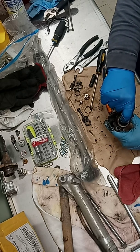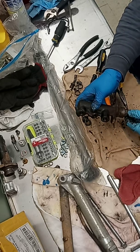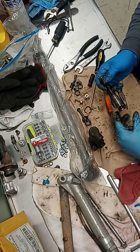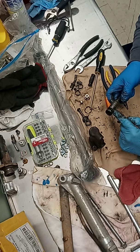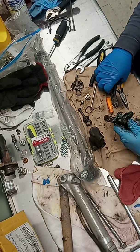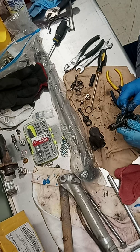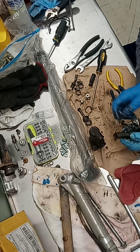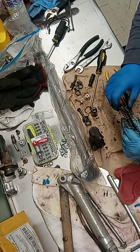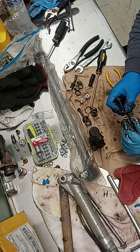Now if you look down in here you can see the piston — it pushes down against that spring. The clip's already out, so this is going to come right out. You just pull straight out, and now you've got an empty cylinder. Here's one seal that will be replaced with the kit. To get to the rest of it, there's a little clip that rests against the back of the piston — get underneath there and pry it up so it'll come off. And that whole thing just comes out. Here's your piston, and to get this apart you push the rod in over to the keyway and it comes right out.